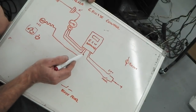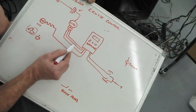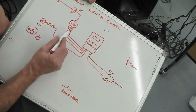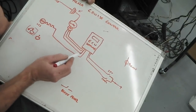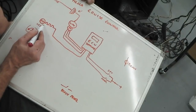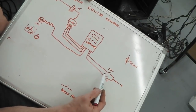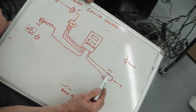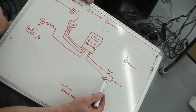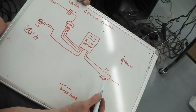In it goes there. So we'll have a wire for that. We're going to have three wires for the motor: the dump valve, the common ground, and then the 12 volts for the actual motor pump. So that's a 3 cable affair. This will only have one cable coming in, although you do need to connect 12 volts ground to your sensor. Two more wires will be coming in for the switches here, so they're on your steering column. I want to set the control on, I want to coast, I want to resume. So set, coast and resume, they do similar functions.